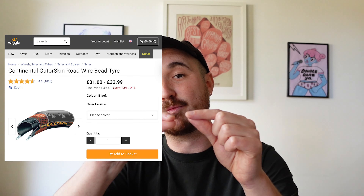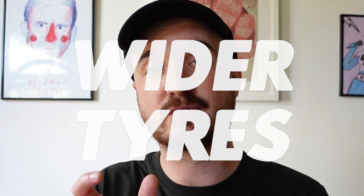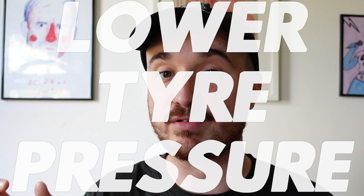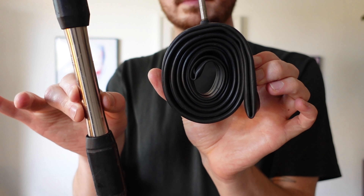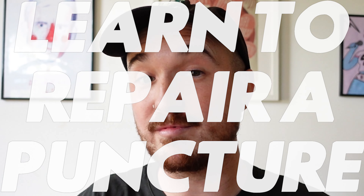There are a few things you can do to protect yourself. Firstly, you might want to buy tyres with more puncture protection — tyres sometimes have a little plastic or thicker rubber layer that protects you from glass and other hazards. You might also want to consider whether the tyres you're riding are wide enough, as thin tyres are faster but less grippy in the wet or ice. You also might want to reduce your tyre pressure in the winter months — softer tyres give you a greater surface area touching the road. You should also accept you're probably going to get a puncture at some point, so carry a puncture repair kit or spare inner tube and a pump, and make sure you've already learned how to repair a puncture before you need to.